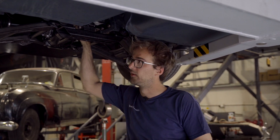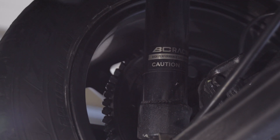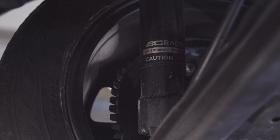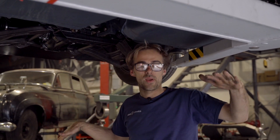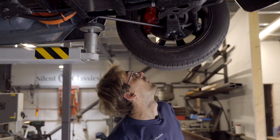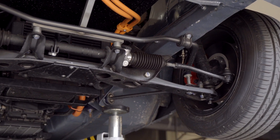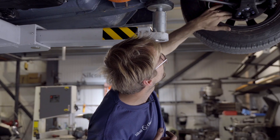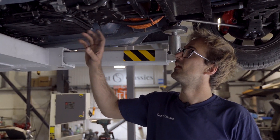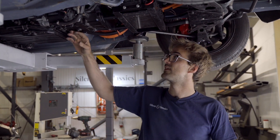We were doing wheel spins on just one wheel and no one wants that. Fairly stock rear end - we're about to upgrade the rear for discs because it does stop well, but we just want it to stop even better. We've got another battery box in the rear where the fuel tank went, which keeps the weight distribution really nice - it's a much better balanced car than it ever was. We've got upgraded four pot Toyota big brakes here with vented discs, anti roll bar. The coolant loop runs through the inverter and also through the charger - we've got one loop and we haven't really noticed it getting very warm yet.